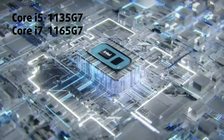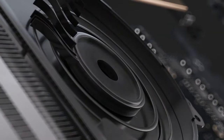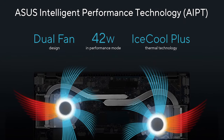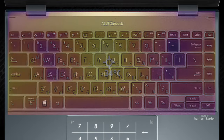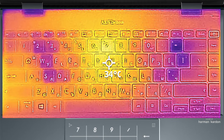In the performance department, this laptop comes with a Core i7-1165G7 as a maximum. Its cooling far exceeds the expectations for a convertible. Thanks to the two fans and two heat pipes, the Core i7 comfortably sits at about 3.5GHz during long runs such as video editing. Maintaining 42W of TDP on a low voltage processor is very impressive. This could not be done if the VRMs were not cooled. We also have to give credit to the software, which allows you to get the maximum out of the CPU thanks to the performance preset. Even after a long period of 100% load, the external temperatures are pretty low — the warmest spot on the keyboard is just 34 degrees Celsius.